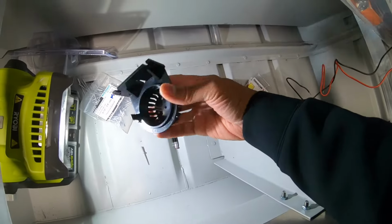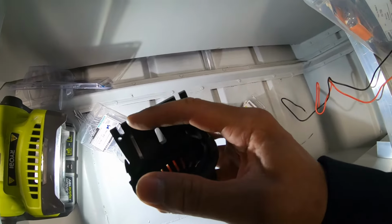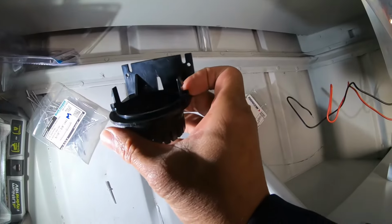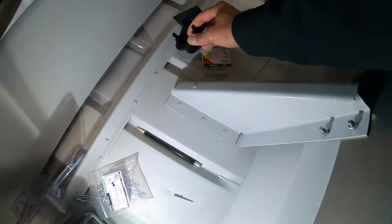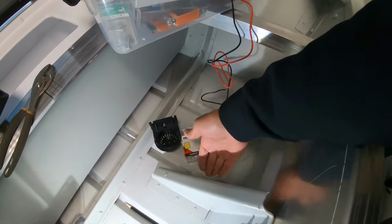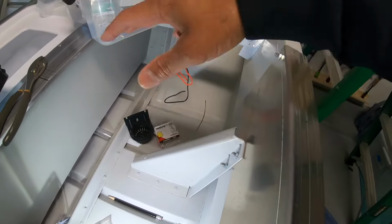One thing I noticed with the casing for this is that you have 2 ways you can mount it. You have these slotted out slots right there, and you've got these 2 holes, and I've already checked those 2 holes hold 1/8 inch rivets perfectly. So I'm actually going to rivet this in, and that's going to pay dividends in this setup because on the back side of this transom support, I won't have screws sticking out where you could possibly cut yourself or poke yourself with that. It'll be a lot more safe and secure riveting this in versus screwing it for this setup.